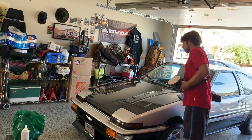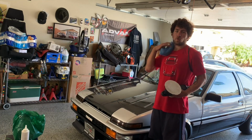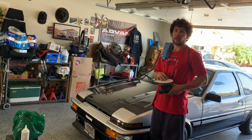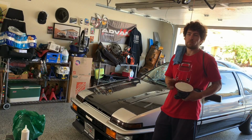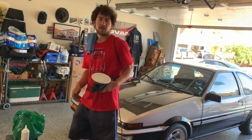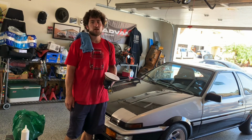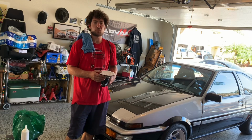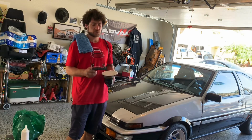It's very difficult to burn paint with a DA on a flat surface. It's more commonly to happen on edges. I used to have a panel that I would use for testing and training, and I held down a DA and a microfiber pad for about 15 minutes in one spot, and I thought that I had burned the paint. It was smoking and everything, and then it was all hazy, and then I trained a new person later, and I went to look at the hood after I had them polish it, and it was gone. So it's pretty difficult to burn paint with a DA.